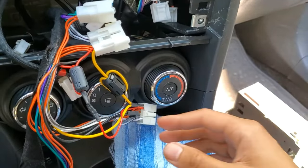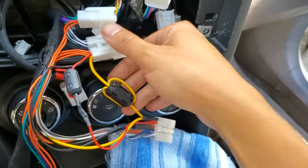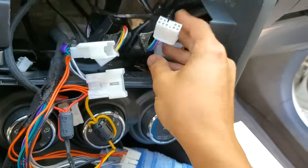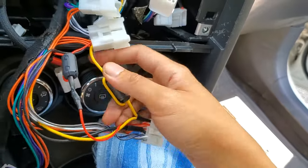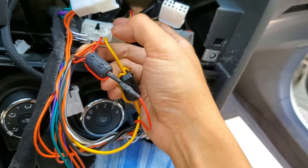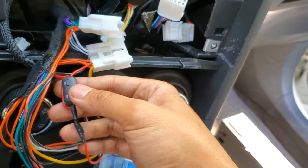What I think is happening is that noise is coming in through the power line from the alternator. This is the ISO harness — these two plugs go to the factory harness for front speakers, power, and rear speakers, and then this one goes to the head unit. I've taken the power wire — which is the top-right wire on the back of the harness — and wrapped it with a ferrite core magnet, and then also did the ignition wire as well.